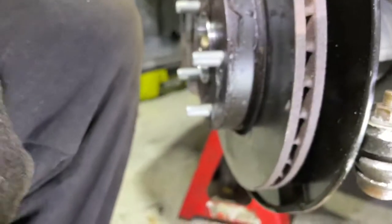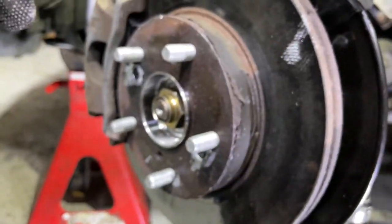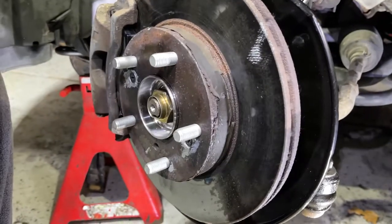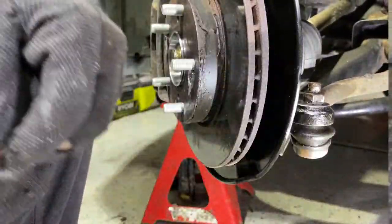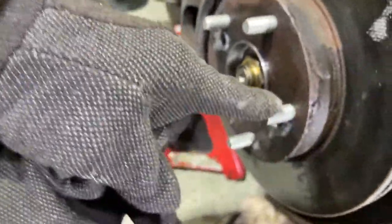The tie rod torque is 40 foot-pounds. I'm going to torque that down, put the wheel on, and jack the car down. Since I'm by myself and nobody's here to hit the brakes, lowering the car will allow me to torque the axle nut down to specs. The other side is the exact same way — I'm going to do the other side but I'm not going to film it. Don't forget to put the cotter pin in. I no longer have control of the steering so I've got to get in the vehicle and straighten the wheel out. I'll put a couple of lugs on the wheel to let it down enough to tighten the axle nut, then jack it back up and put the wheel and hub cap back on. Don't forget anti-seize on these threads.